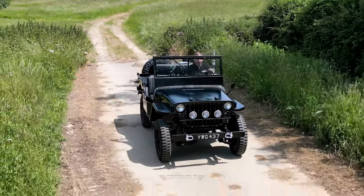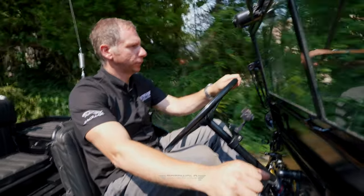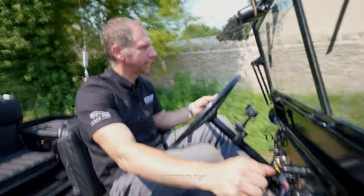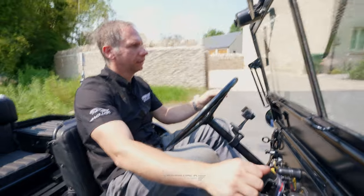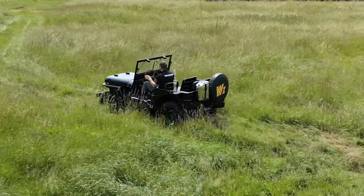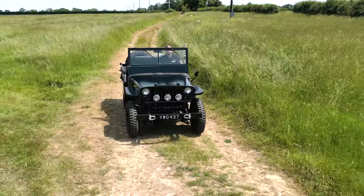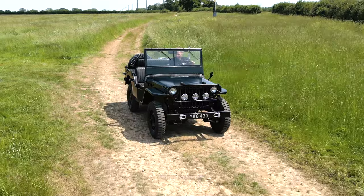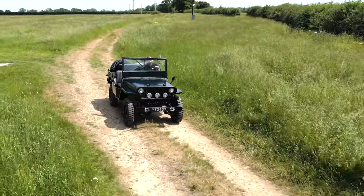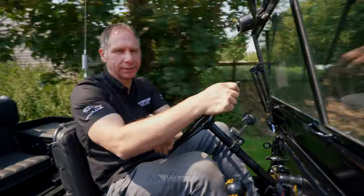Can something like a misfire just rectify itself after a bit of driving? Yeah, depending on the cause of the misfire, seldom do problems go away or improve on their own. They tend to get worse. If you've got a small piece of debris somewhere and it goes through the system, then yes. But if you've got things such as the ignition system or leads breaking down, they tend to get worse.